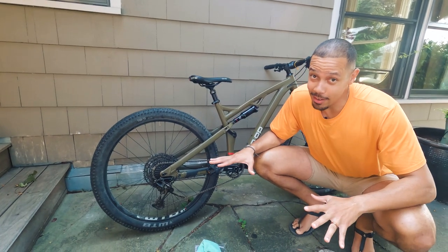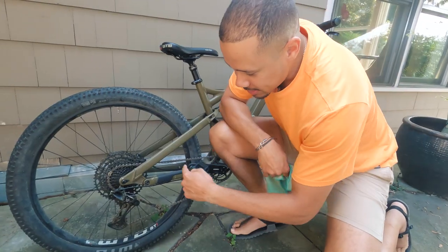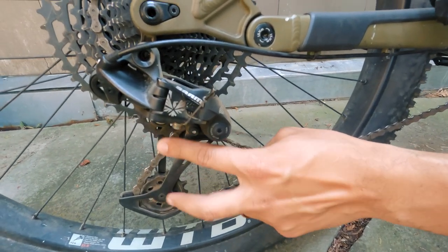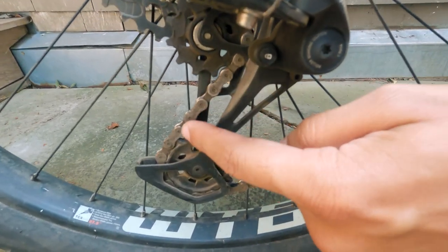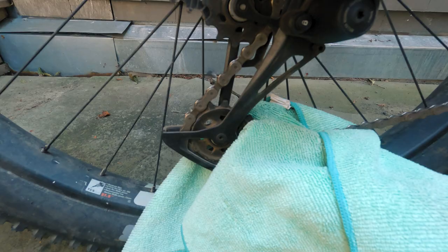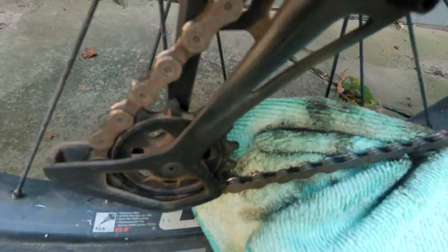Now here's a chain that needs some love, so let's give it to it. I'm going to start off by grabbing my rag. If you notice, most chains go through a derailleur, and on the derailleur there are two pulleys. These little things have teeth that go through each and every single chain link. So what you want to do before you add lube is remove the dirt from these pulleys. You don't have to hold it tight — just lightly place it with your two fingers around the pulleys. Grab and spin — look at all this. That's gross. That's just one pulley.